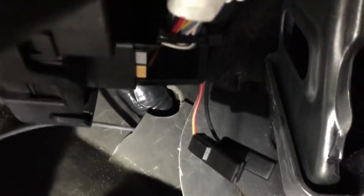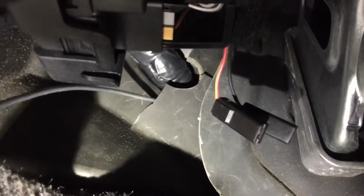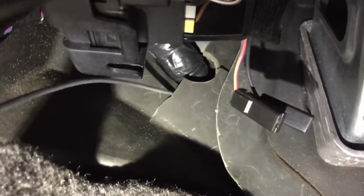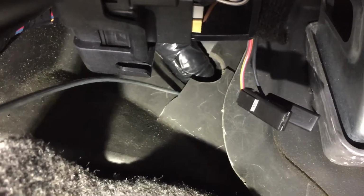the wall there. We took a spindle of wire and we jabbed it to the bottom right side of it and basically pushed and pushed. It takes a little bit of time and patience, and you kind of feel like you're hitting a piece of rubber at the end, but just keep pushing a little bit more and it ends up popping out on the other side.